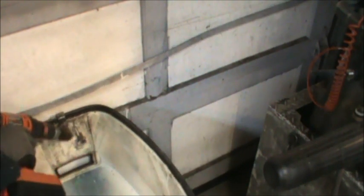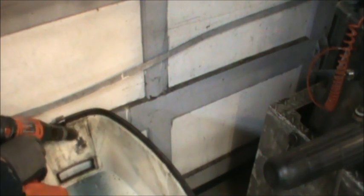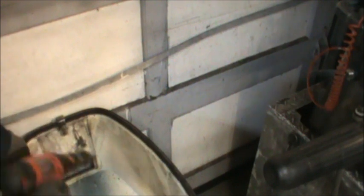I'll wipe off that excess here in a bit. Look at that inside there. For the Coro Seal to work, you need to wire brush it first, really. You need to rough it to get all the scale off there. Then you can put the Coro Seal on there. And as far as this, this looks like it might have been brass. So I just put some Coro Seal on that and take care of that. But man, it's so uncalled for.